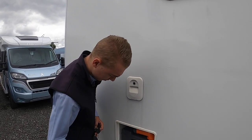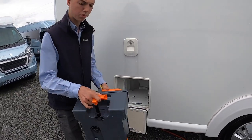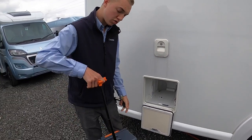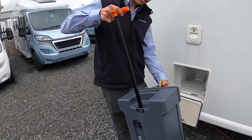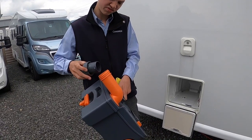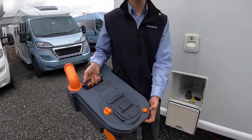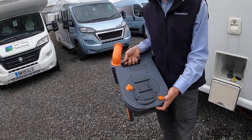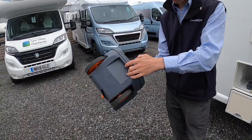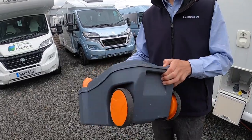Below, that's where your toilet waste ends up. You can lock it — as long as the slide on the bottom of the toilet is closing, lift and pull the cassette out. You can drag it along once it's full as it has wheels. To empty, take the cap off, press the button at the back to stop the glugging and give a consistent flow, then tip out. Once emptied, put some water in, give it a rinse and tip out again.